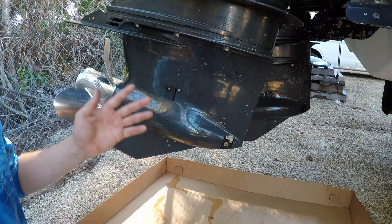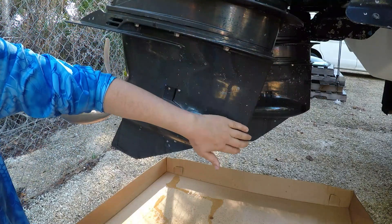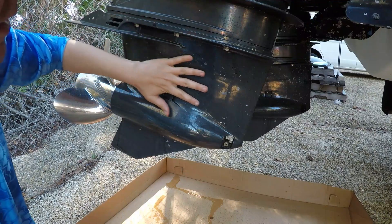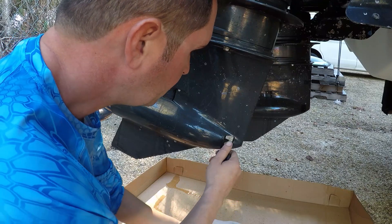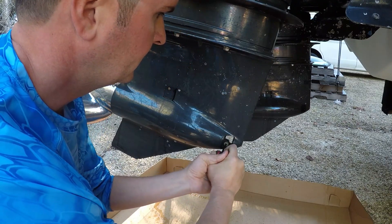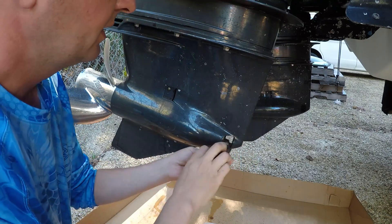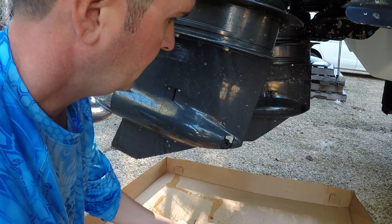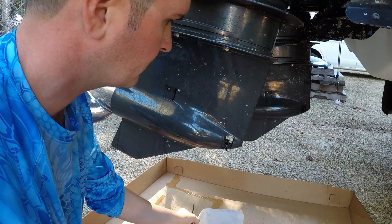It's the same size plug that takes it out, so when you're draining it, tip the motor up all the way to its full trim. I wouldn't tilt it all the way up but just at this angle so everything runs out. Hopefully this one is easy like the other one. All right, so here's our drain plug — just because the oil is not coming out yet doesn't mean anything's wrong.